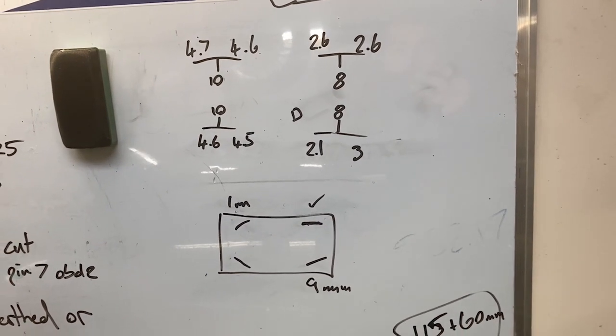So that is how to do string alignment on toe-in and toe-out — just a quick overview. Before you do any of this, you normally have to do your ride height, tyre pressure, and stuff like that, and then you'll put it on these caster plates so your wheels are nice and floating. Proper race car setups, they take the wheels off and have stand things. You normally do camber and ride height first before you do this, and your tyre pressures. Once you've done that, you do your toe. With string alignment you can also test caster as well — that'll be in another video.